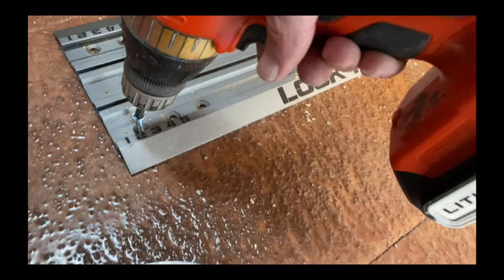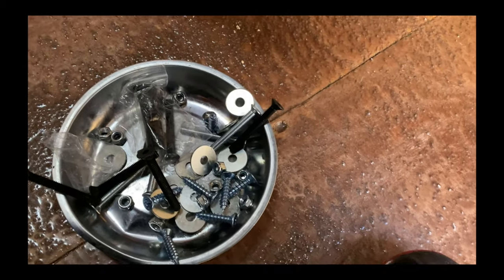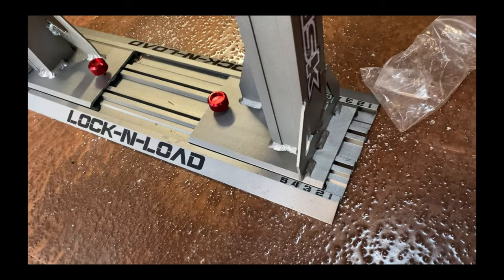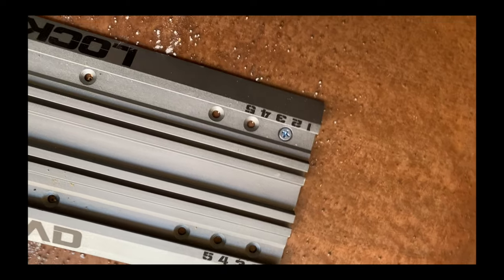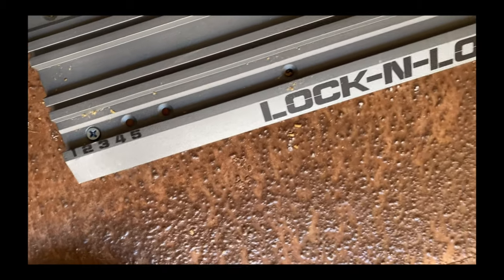Now I'm using the wood screws that come with the package. There are different types of bolts — the black bolts are for the truck mount, while these wood screws are specifically for wood floors, which I have here coated with epoxy. I might also use one of the additional holes and fire through with machine bolts with a nut underneath, which required me climbing under my trailer. That said, I already did one and it's really strong as is — I don't think the additional machine bolt is necessary, but if you've got the time and the hardware, go for it.